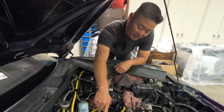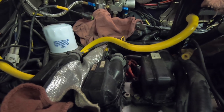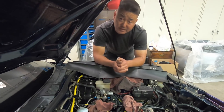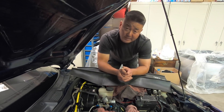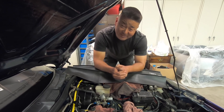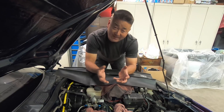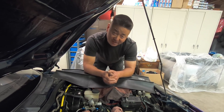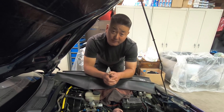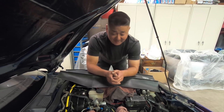The second thing — you can kind of see on that primary coil — that is dielectric grease. When we were racing back east between the rounds, we had an issue where a primary coil was giving way. I would typically change them every three races but every now and then it just wouldn't hold up. At ATCO, we did not have enough time to pull the manifold and change the coils. Someone who races top fuel had once told me that if you ever get in a jam, take dielectric grease and basically surround the coil with it. If you get into a jam and you need to make the next round, try putting dielectric grease around the coil completely. That actually allowed us to complete the race and win.